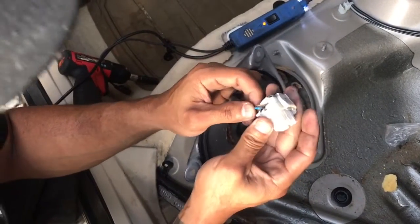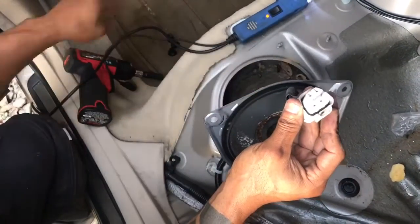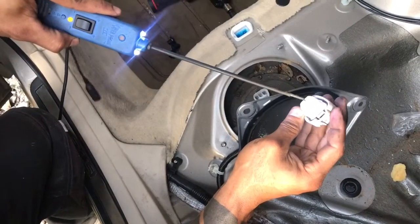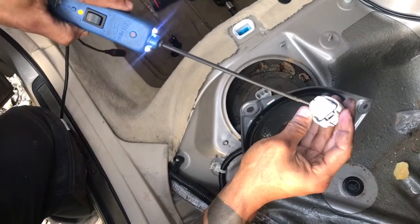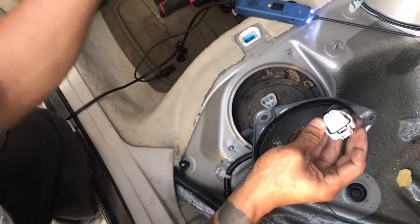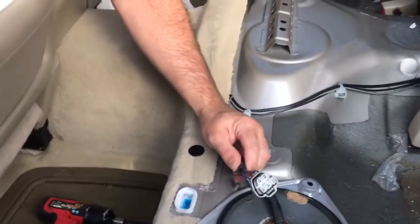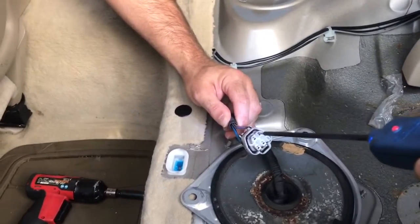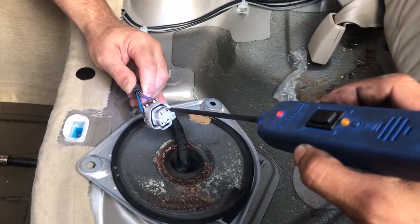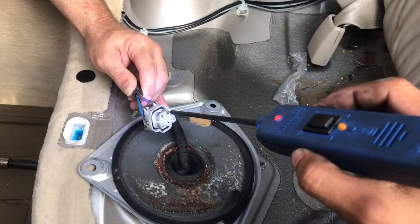That, you know, it tells you how much gas is in there. So what I'm going to do is, let's see, these 2 bottom ones are the big wires. So I'm going to have somebody try to start the car, and I'm going to see. So they're both getting ground right now, right? So I'm going to see if it gets red on one of these when he's trying to start it. That means the power is going to the fuel pump. All right. Can you please crank it? See red? All right, now stop cranking it. All right, crank it. All right, stop cranking.